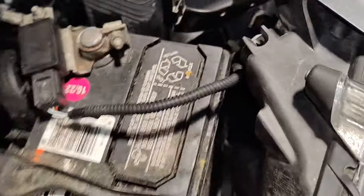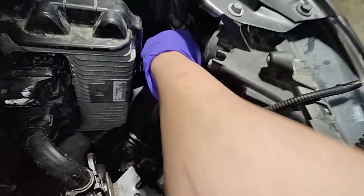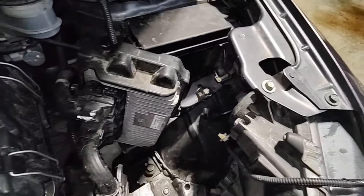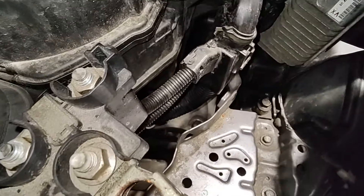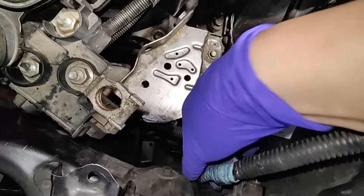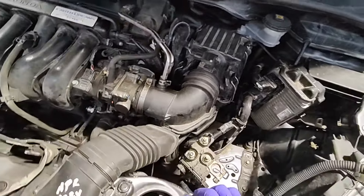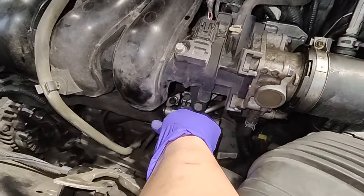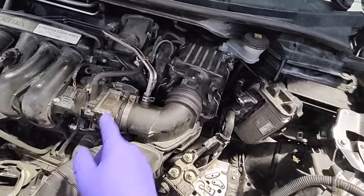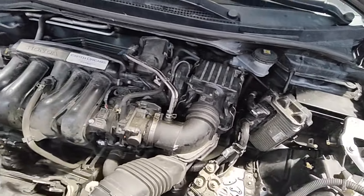Let me take the battery out and show you. The things that I see: this is not connected - this is the headlight. The PCM is not even tight and I think they cross-threaded it because I can't even turn that by hand and that thing is loose. What else did they forget? I'm looking for a ground - maybe they didn't connect the ground properly. I might as well put some of these things back. I'm gonna keep looking and see if I can find where our issue is, because these grounds are okay - these are nice and tight. These are the main PCM grounds. But there's also the ground from the engine to the body, and that cable looks okay, they're not corroded, it's tight. So I'm gonna do some more poking and see what our issue is.